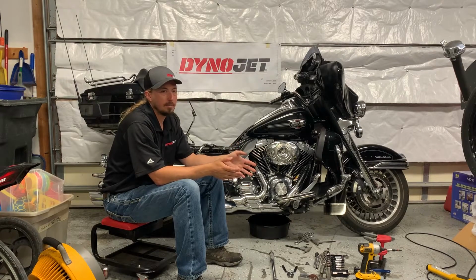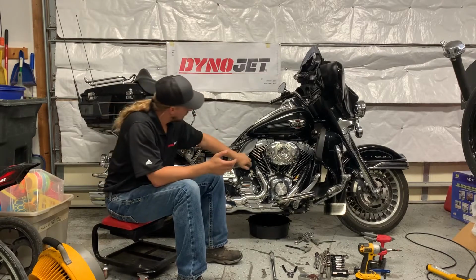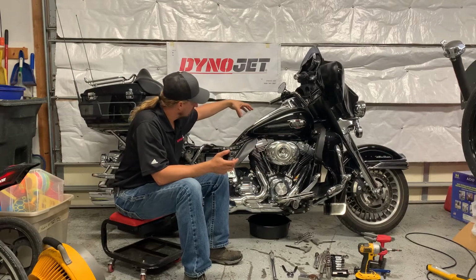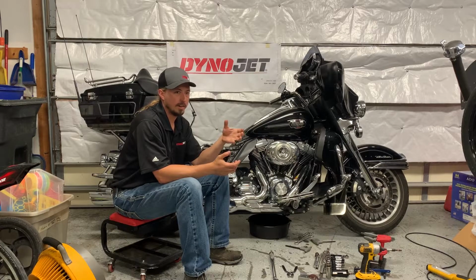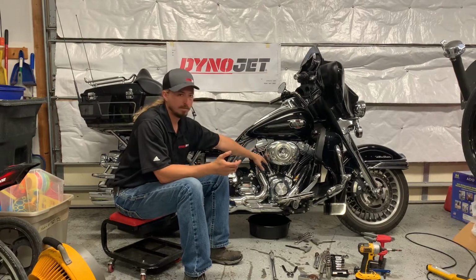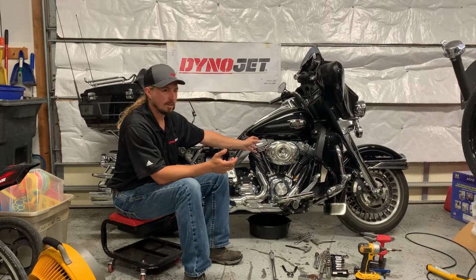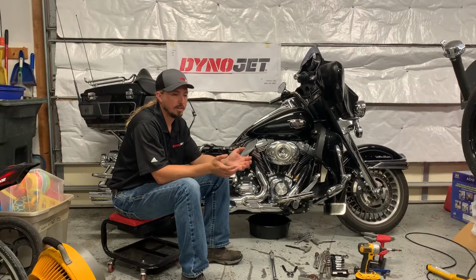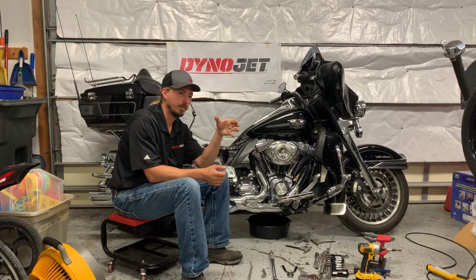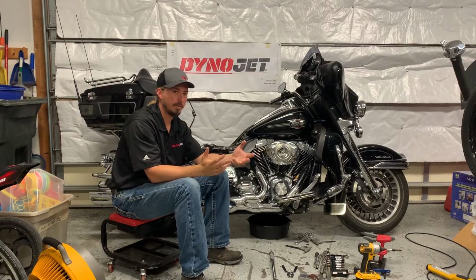But meanwhile, when you're putting the cylinders onto the piston assembly, and keep in mind, these cylinders are going to come down onto the piston and connecting rod assembly, which you're already going to have put together and attached to the motor. Because of how that arrangement works out, a standard piston ring compressor, like what you would use on a normal water-cooled engine, where you're feeding the piston and connecting rod assembly through the top, won't really work because you need to have a way of getting it out around the bottom.